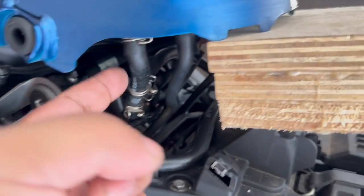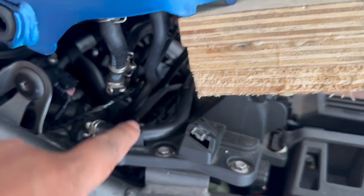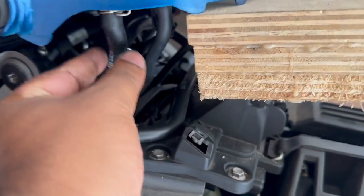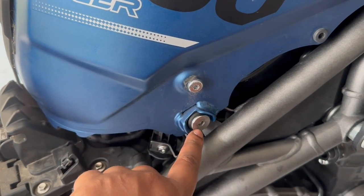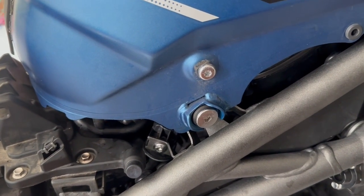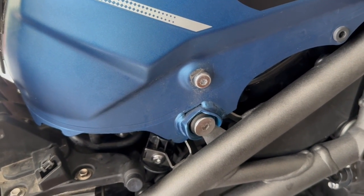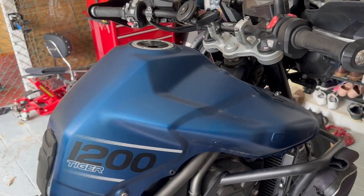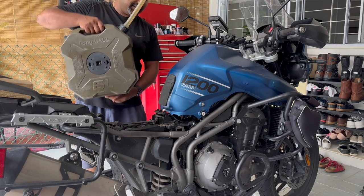The last fuel rail was actually accessible with the tank still raised — it was just stuck with some other hoses. I've put the metal clamp back on using pliers. Now we're ready to drop the tank and fix the two 6mm hex screws — one on the right side and one on the left. Torque them to 12 Newton meters — that's about 106 inch pounds. The fuel tank is now installed and everything is connected.